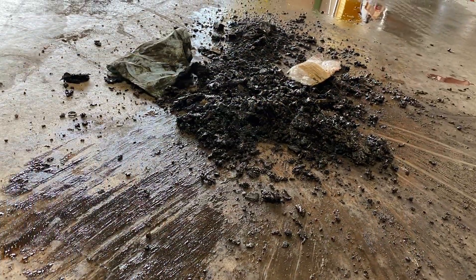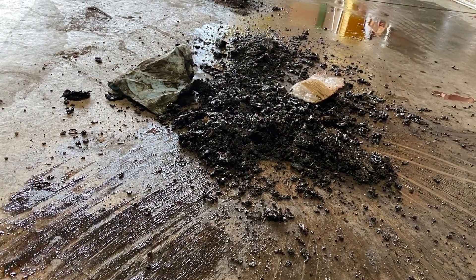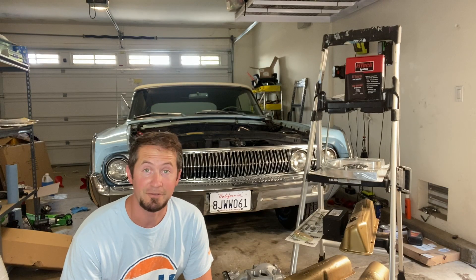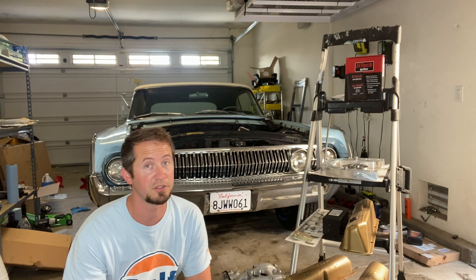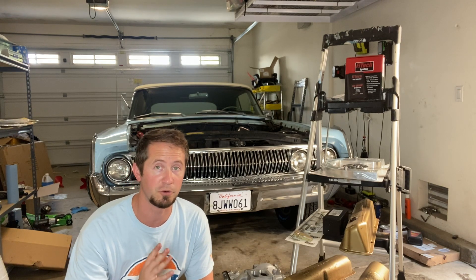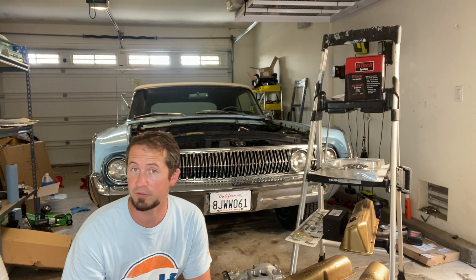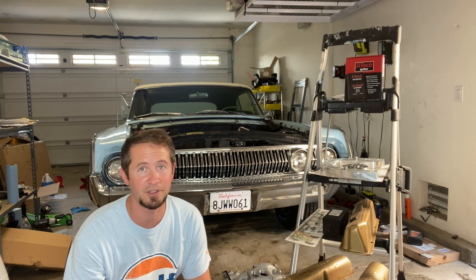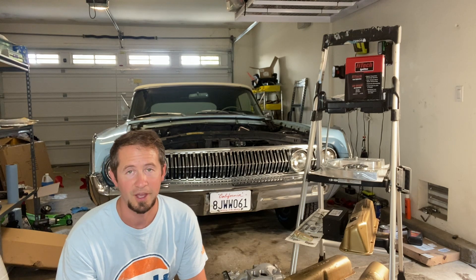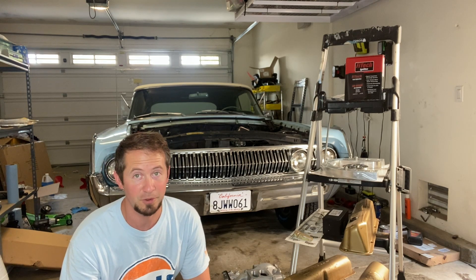Here's just part of the nasty pile of grease that fell out from under this car. So I have taken the engine out — it's already gone. The transmission's gone too. The original three-speed Cruise-O-Matic worked fine. I had fixed the shift shaft seal, the rear seal, the rear bushing, done quite a bit of work to it, but I wanted overdrive. So that's what I'm doing.